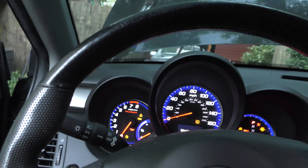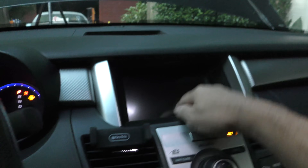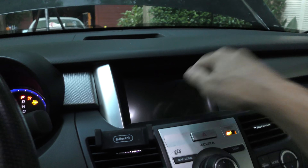As you can see, we turn it on, the car starts and runs fine, but all that infotainment is completely dead. I sincerely doubt my customer wants to drive his car like that. But this is kind of an interesting situation, because when you put that fuse back in everything works perfectly fine, but when you park the car it starts draining the battery. I'm going to have an interesting fix.